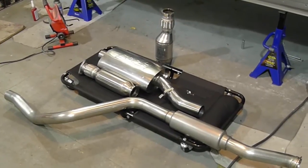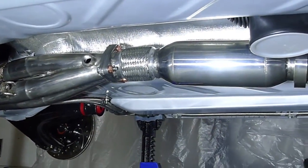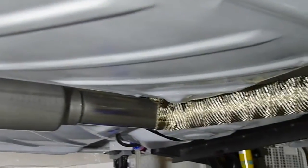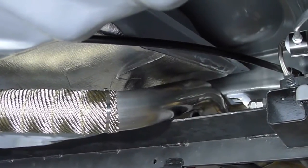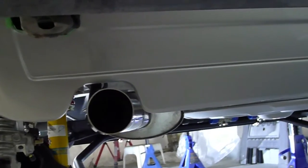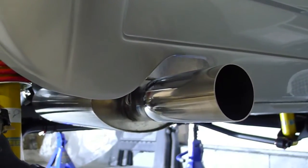That was my weekend — lots of work, probably about 20 hours, but it fits perfectly. The exhaust system is in now. I've got good half-inch clearance at the shifter boot. I've got a little titanium exhaust wrap where the fuel tank is, and there's enough clearance there. It's a little bit close to the axle, but the axles drop about 4 inches so there's a little space when the car is on its feet. At the back there's a beautiful view — it's great to have that 2½-inch stainless pipe sticking out, about 3 inches, which I think is tasteful.